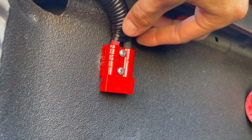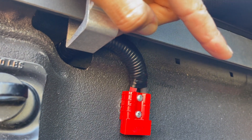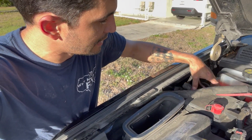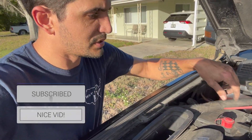I've got my connection nicely mounted, wrapped in some conduit, feeding down into the body of the truck. Let's get this cable ran up to the front of the engine bay. Every single truck is different so I'm not going to show you how I ran my wires, but I've got my positive and negative ran up into the engine bay. My alternator is right there — I just need to get these connections going and I'm going to put this on a fuse, just like I had in my last setup. That's pretty much it — that's how you install a DC-to-DC battery charger.